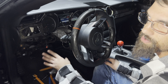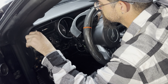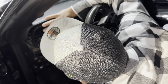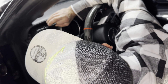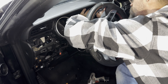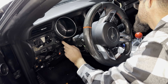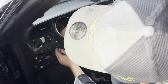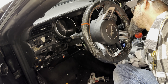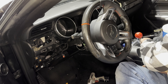If you don't make sure the tabs line up, you can break the little plastic holders, and those are what lines it up — so don't break them. We're getting close to fully putting on the gauge cluster. Try to get both tabs in at the same time. There's a vent in the back, so feel for it. Once again, you have those tabs to help guide you. Make sure everything is lined up — as you can tell, mine is lined up. Once I screw it down it's going to hold. Take your long screws and place them back at the bottom — your long screws go only to the bottom.